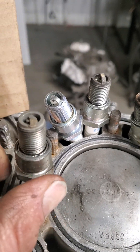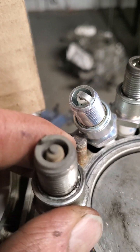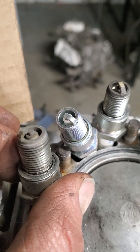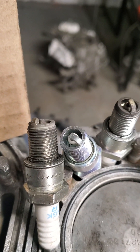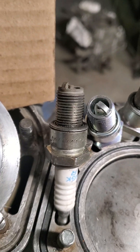Here's an interesting one. If you have good piston clearance, you can actually — and we were way too lean on the jetting with a new carb setup — ate the plug back and luckily didn't seize. Normally, if it wasn't a loose engine, we would have seized.